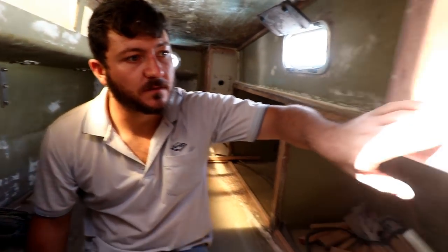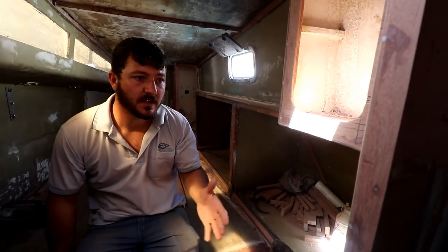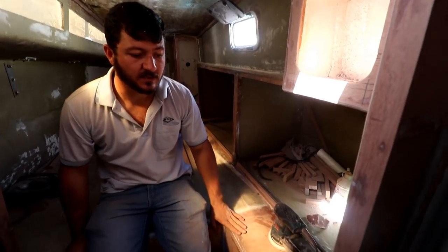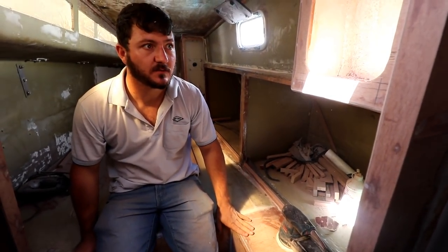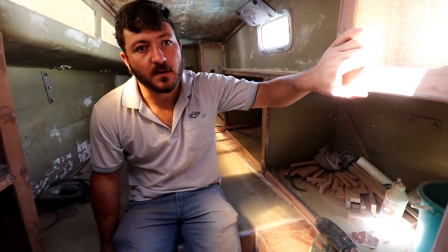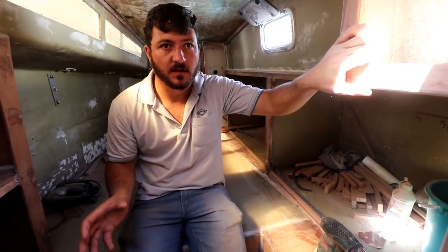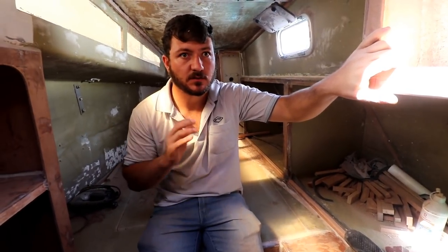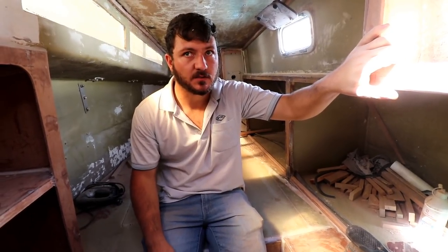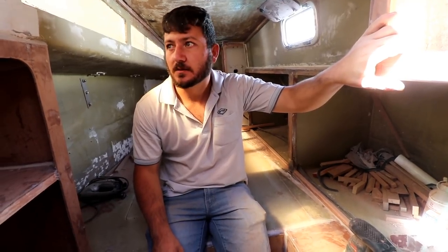And now we'll go and we'll fill all the little pit holes. If there are any pit holes, we'll fill that up again. Sand again, primer, sand again, and then touch up with primer again, and then two coats of final. We'll do one coat of final, and then finish up everything on the boat, and then do that final coat pretty much after the wiring and everything's been done, just so we don't have to. Hopefully that best case scenario will be like that.